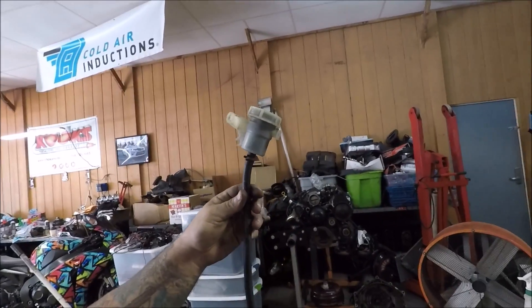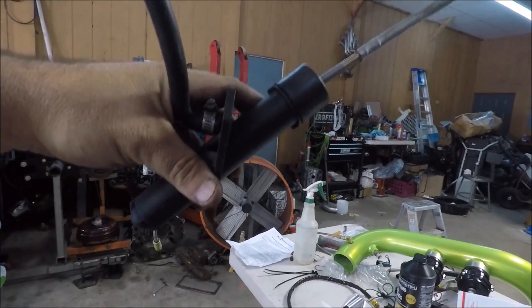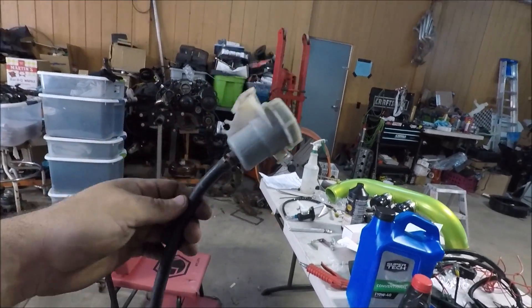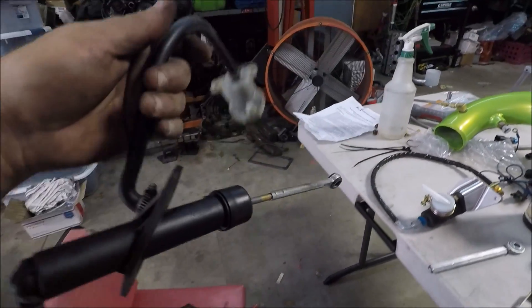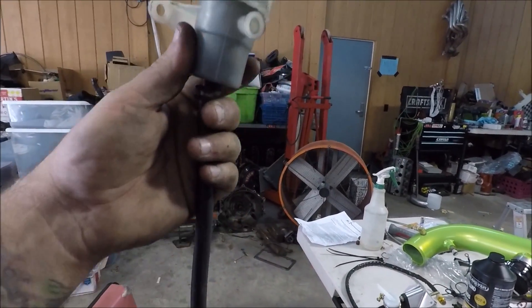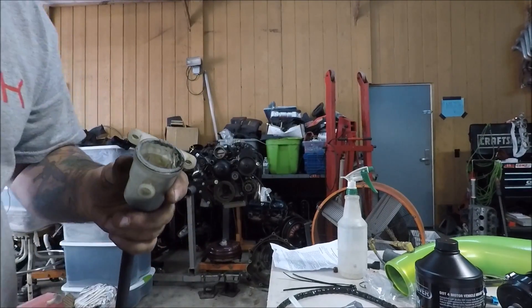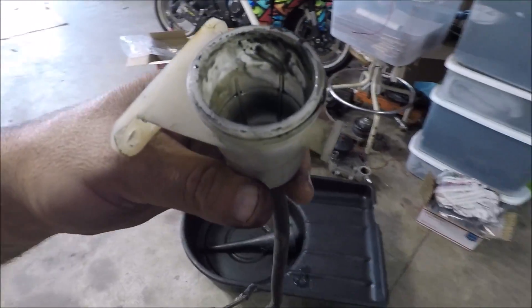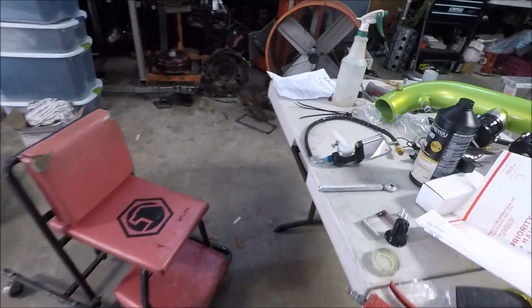The first thing you'll need that's not included in the kit is your reservoir. The F-body clutch master cylinder sits in the firewall like this, with the reservoir sitting up in the engine bay. You just unclamp it, pull it off, and stick it on the new unit. While you're doing that, I highly recommend cleaning it out — this old dirty one is pretty disgusting inside. Dump the old fluid out, clean the reservoir, and blow air through the line to make sure it's not clogged before you put it on your TIC master.